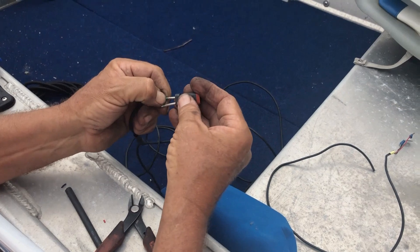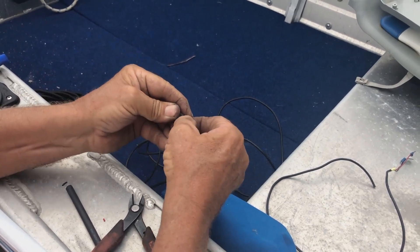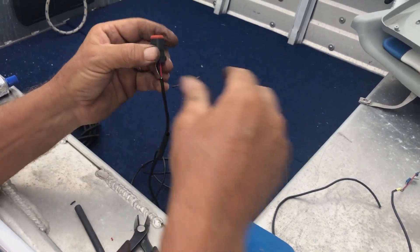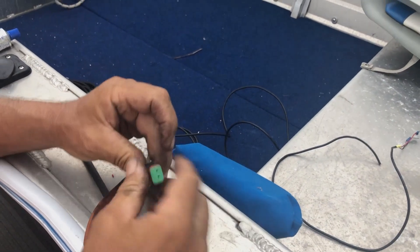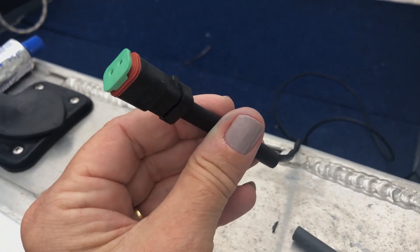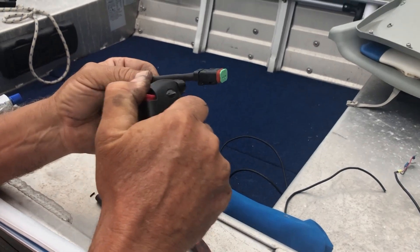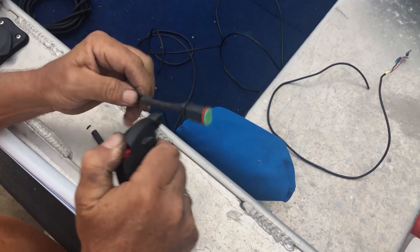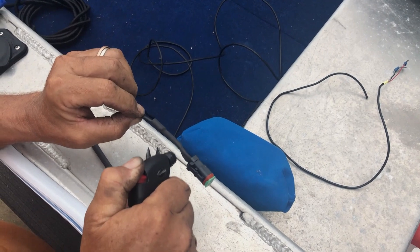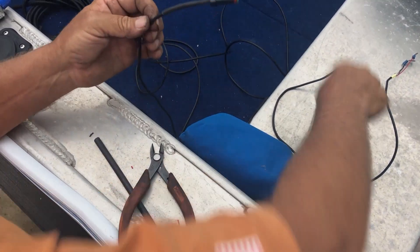Pin two is negative — just like that. We do a little fancy stuff here with the heat shrink. Click, click — one more click, there we go. Second click: that's when you know it's seated. Then we'll stick that back on there. This is dual wall heat shrink — it's got an epoxy glue inside it, so not only does it shrink down, but it glues onto everything and seals perfectly.